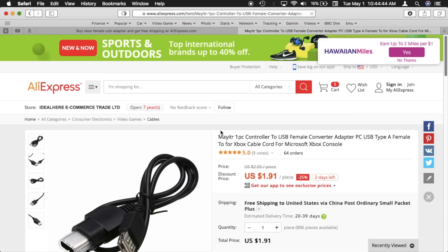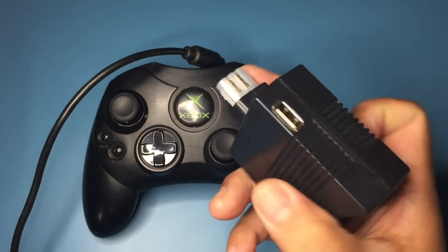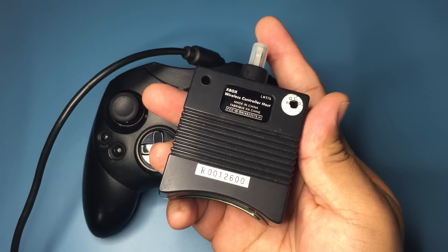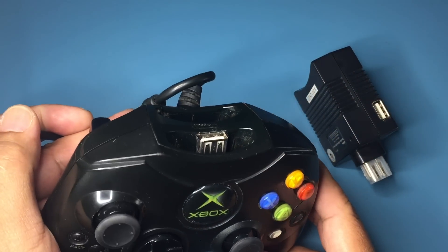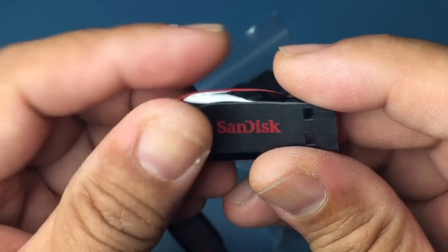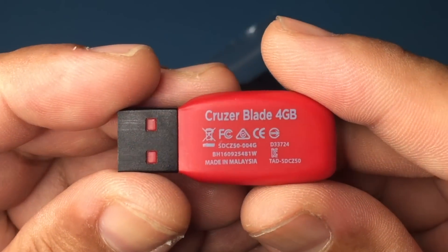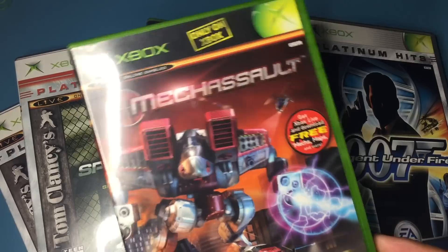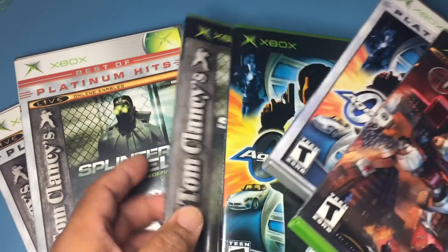Here's a wireless receiver that I don't have the controller for, and luckily I saved an Xbox S controller I got years back from a swap meet. Both are modded with an added female USB adapter for the USB stick. Instead of going through the headache of finding a compatible memory device, just get the readily available 4GB SanDisk Cruzer Blade memory stick — it can be had for under $6 from AliExpress. The last thing needed for the Xbox soft mod is a compatible game disc, which I'll cover in detail in the next video.